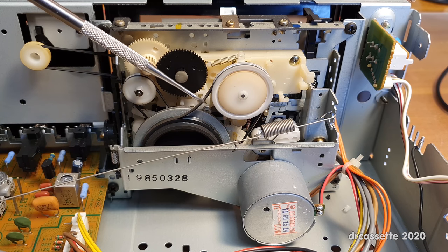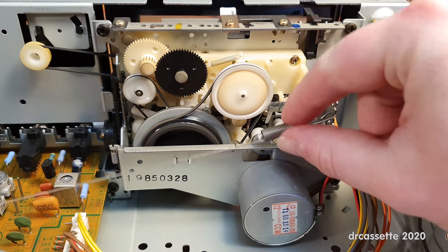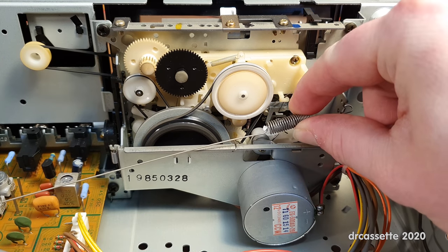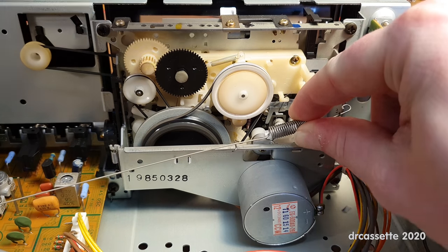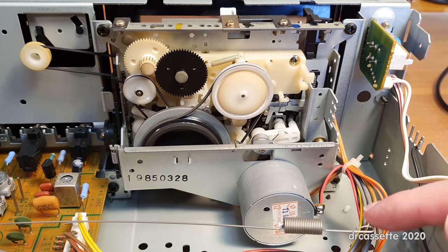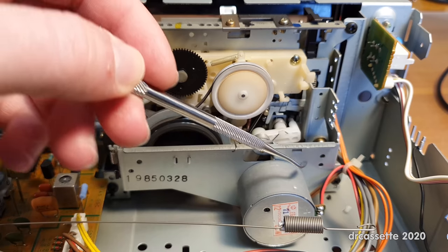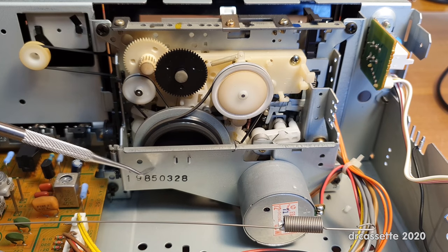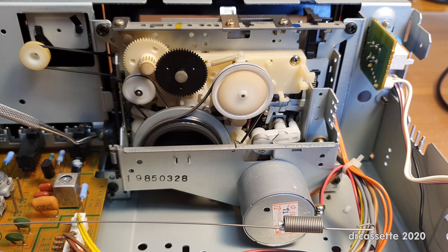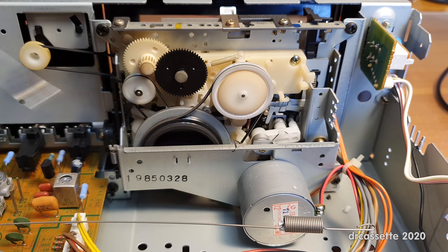So now I can carefully extract these belts while they are still intact. To do that, you can disconnect this spring right here. This is the linkage that connects this mechanism to the record-play switch on the main board. All these cables right here, thankfully, are socketed on the main board, so that's not a problem. This bracket holding the motor in place has to come off, but the screws holding this in place are on the sides so you can't get to them — so this whole entire mechanism needs to come out.